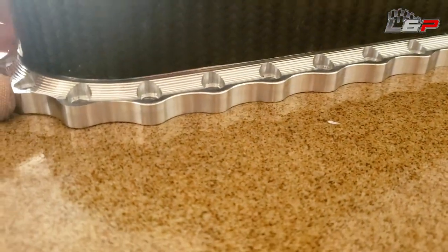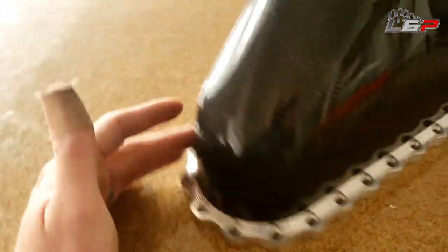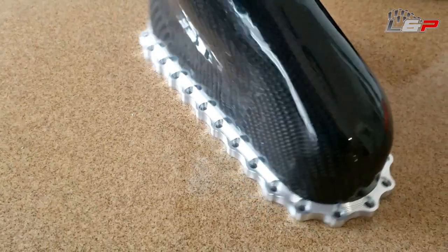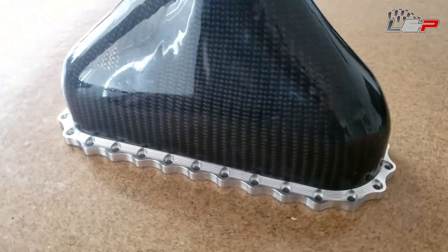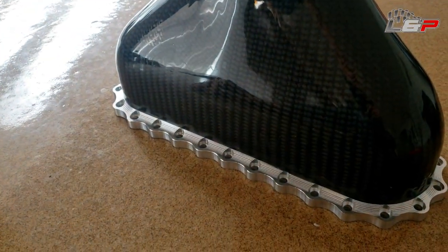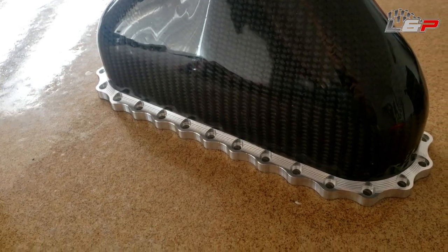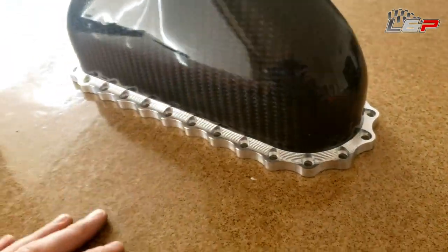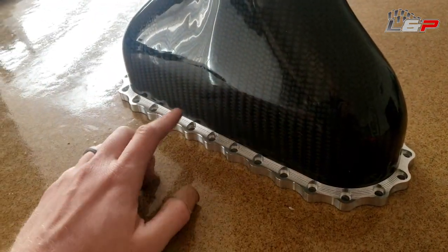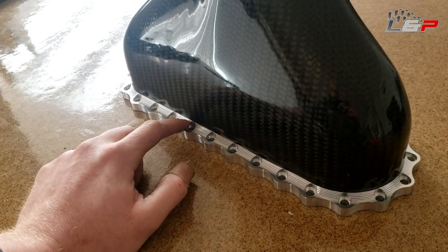So I did go ahead and just shove this thing on. It's just roughed in. I didn't belt sand the part to get it fitted up perfectly. But it does fit, it's snug, so I'm going to have to relieve a little bit of the pressure or the extra material on it to, you know, get a better gap. You want a little bit of a gap, sort of a slip fit for the adhesion, so you have a good thickness of epoxy in there when you bond this, but it's pretty good. So I think the next steps that we're going to do now, I'm going to take this flange back out of here, and we are going to pull the intercooler out of the truck.